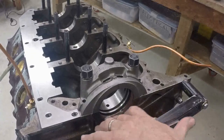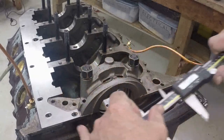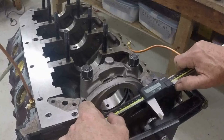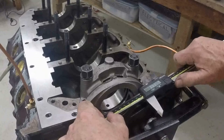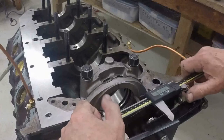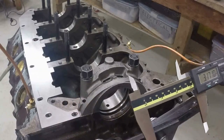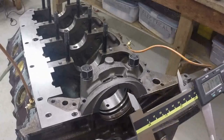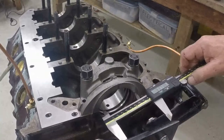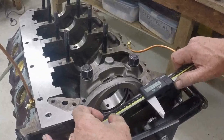I have the seal trimmed down in there now. It's nice and smooth. There's no bumps. There's no distortions. So we'll measure and see what diameter we have on the inside. It's about 3.171. Remember the sealing surface on the crank was 3.185. So that gives me 14 thousandths smaller for the sealing surface, which is just about perfect. It is not under 20, which is the limit that BOP says.